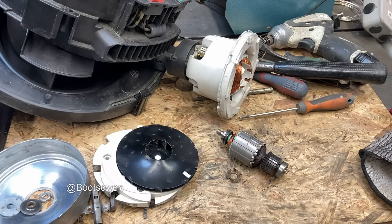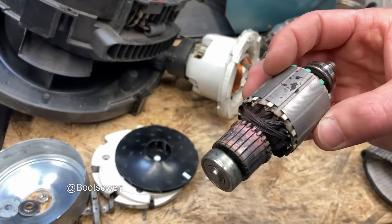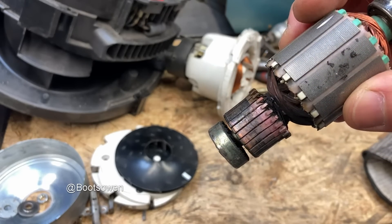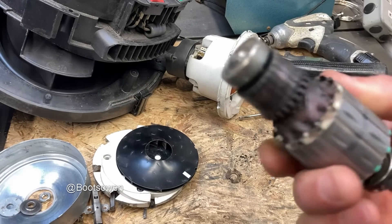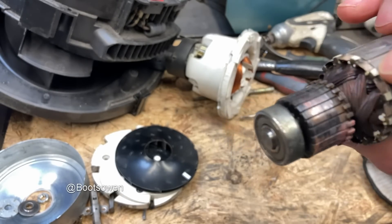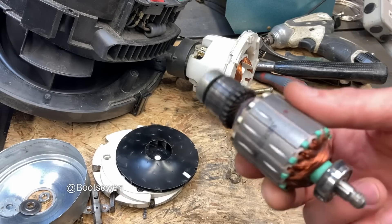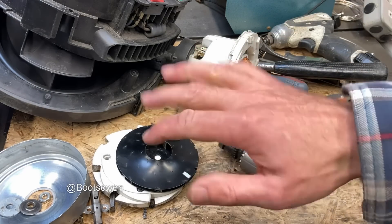It's not looking good for this machine. I suspect the hi-low and everything else is working on it, but that's properly cooked. You could put it on a growler and test if it's working, but I'd say it's not. I'd say that's your issue — some of those wires in there are burnt. If smoke's come out of it, I can't really see it going again. You can see it should be bright and shiny like that end, but the heat has done that to it. I don't think sweeping it out with a wire brush is going to do anything for it because it's so bad. So autopsy, if that's what we want to call it. Questions or comments, leave them below. Thanks for watching. See you later.